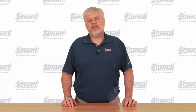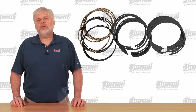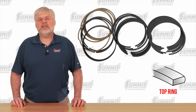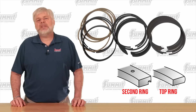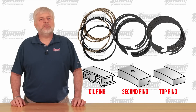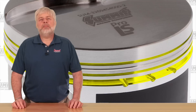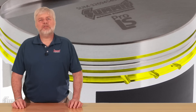Pro LS Piston Rings are the very best quality available, and Summit has kept them priced affordably. The steel top ring makes them very durable yet low friction, and they are perfectly round to ensure a full 360-degree seal around the cylinder — this is called light tight percentage. The ductile napier second ring does an excellent job of controlling oil, meaning oil ring tension can be reduced, which reduces friction and increases power. The Pro LS Piston grooves are precision machined for optimal ring contact and seal, with a very flat mirror-like finish, and cut with a slight positive angle for better ring seal when the lands grow with thermal expansion.